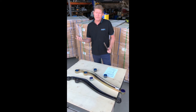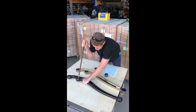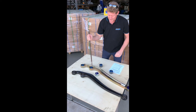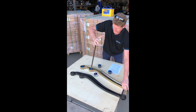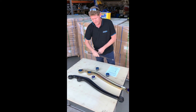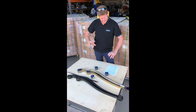When we talk about conical stiffness, everybody talks about flex up in a bush. If we put a bar in this bush and pull on it, we can get some flex in the factory bush — they're quite rigid. The new poly bush is massively different — these things have huge flex, so it's a very, very good bush.